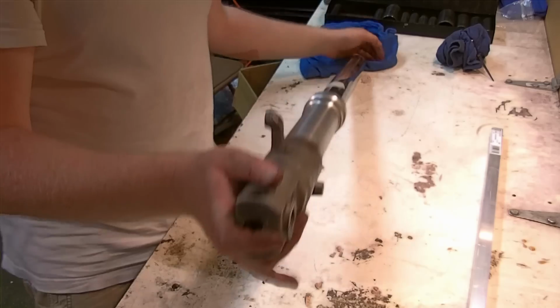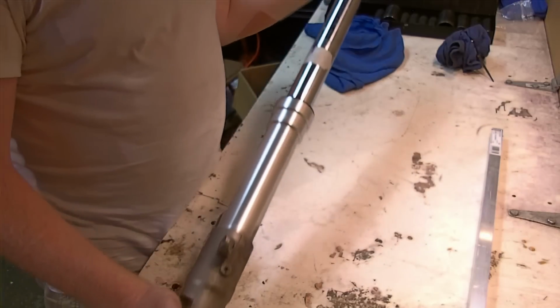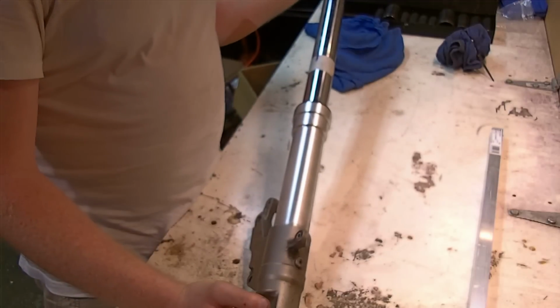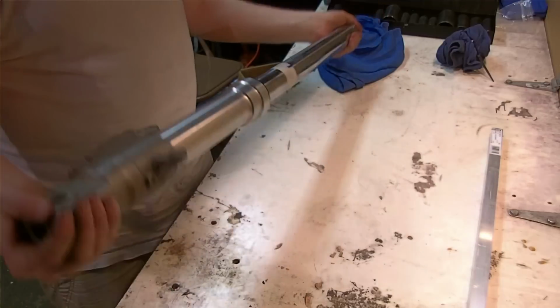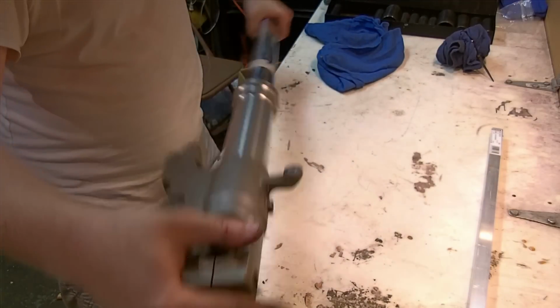There is a very big spring inside this fork. Shake that socket out. We've left the cap on. There is still tension on there. We might have enough tension to just turn this out with a ratchet and just crack that bolt loose there. We could try and have a buddy, or if we're ambitious ourselves, compress the fork against our bodies to keep more spring tension on it while trying to crack that loose.